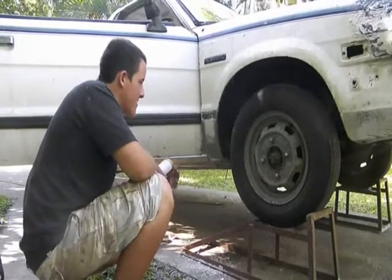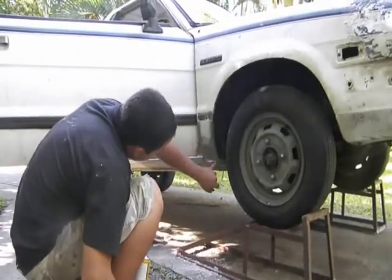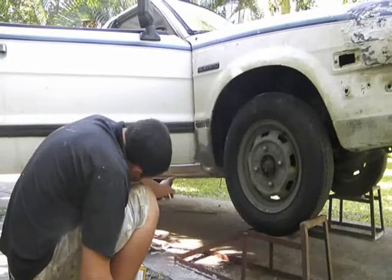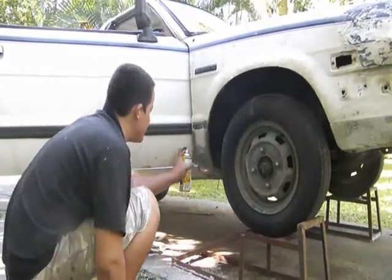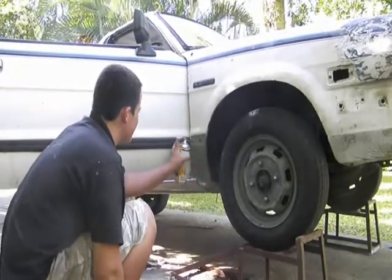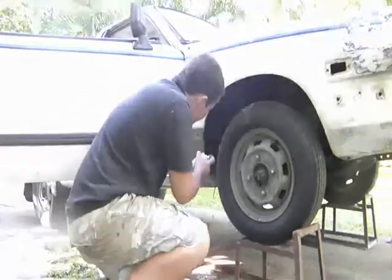Just finished doing the initial bogging of the patches that we showed you before. As you can see, it's turned out pretty good. Covering up that groove there, and just going to try to sand it into here. And that's the patch under the door there. There's no more rust hole there now. You've just given it a light coat of undercoat so it doesn't rust till you get back to it in a fortnight or so, eh? Yeah. Looks good, mate.